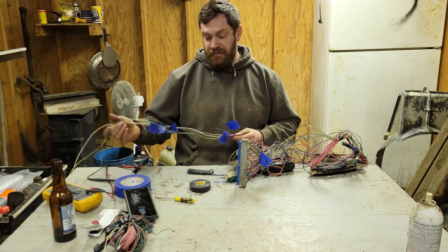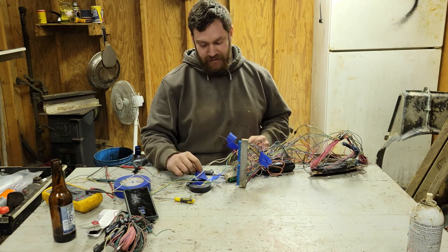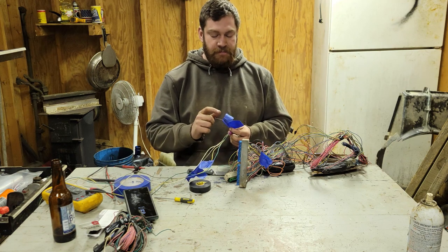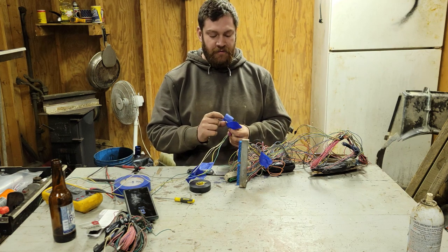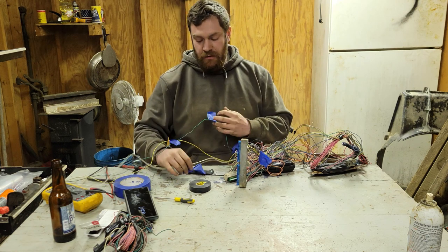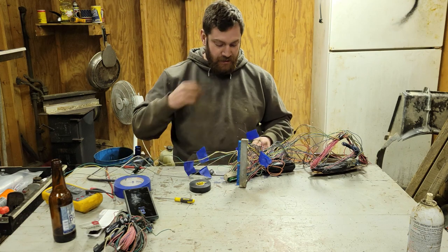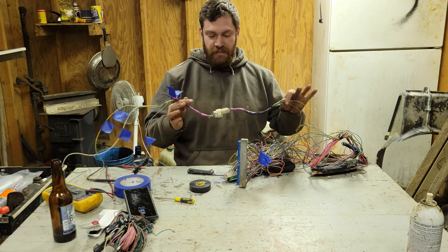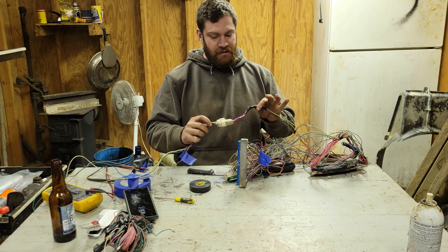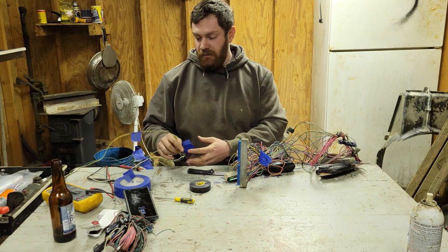and just stuff that you need to hook up outside of the engine transmission itself. So I have a cruise control, like a vehicle speed sensor wire for your cruise control. If you want to put that in, I might, it's hard to tell. My OBD2 wire, my tach, my fuel pump, and my check engine light. I got this plug that I had removed from the harness, and it had just enough wires on one side and a couple too many on the other. So I came through here and I just labeled which ones I wanted to be which.